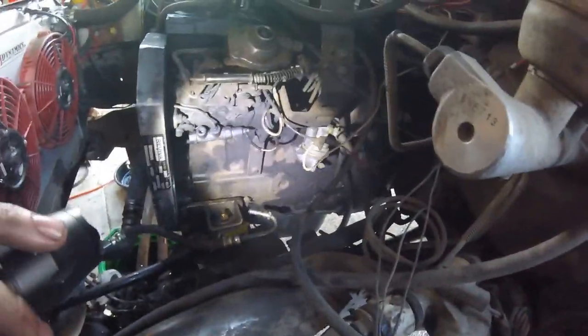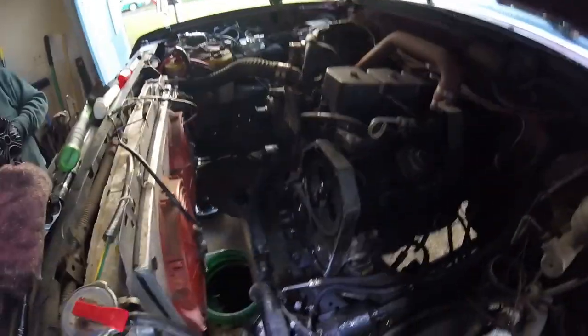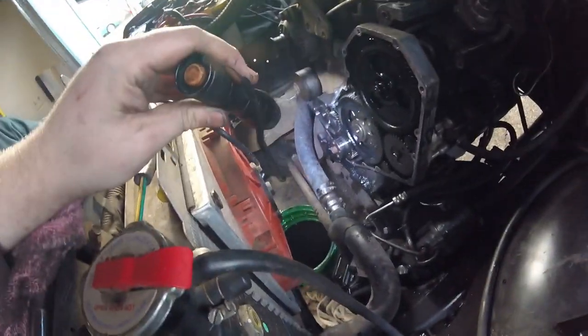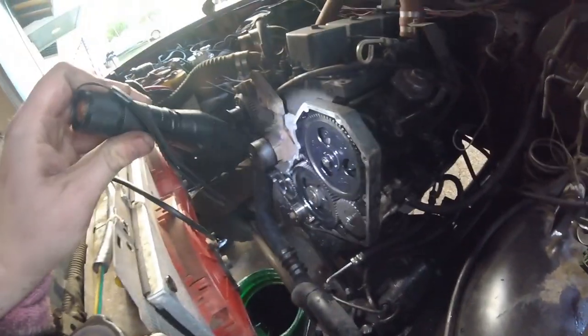In that aspect. Now we got the pump in, got everything hooked up. Now we got oddball things to do. I gotta put that repair sleeve on the crank there and then put a new seal on the front cover, and then Todd will reassemble the rest of it and we'll see how that pump works.